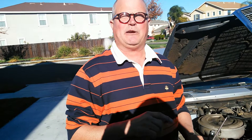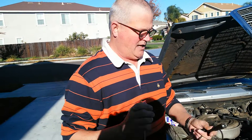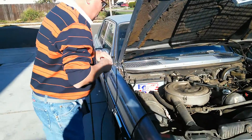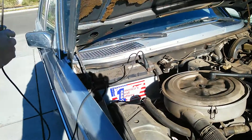That is, check and make sure, first of all, that you've got a good positive battery that's got 12 plus volts to it. And then from there, what we're going to do is check the starter solenoid on the car. So we'll take our handy-dandy test light and hook it to the positive terminal on your battery.